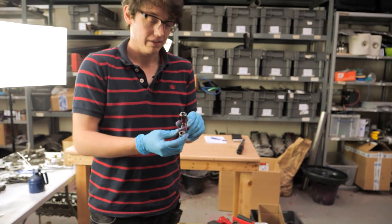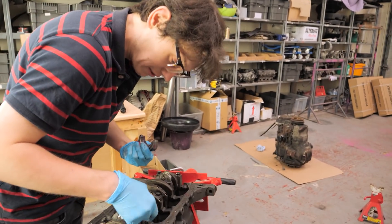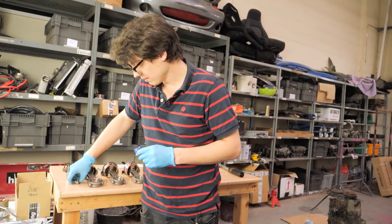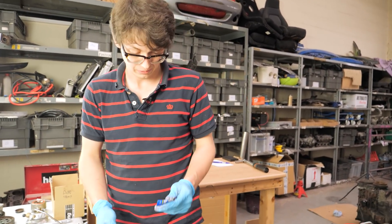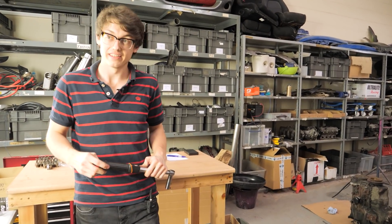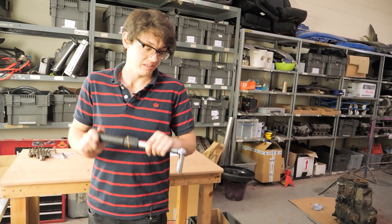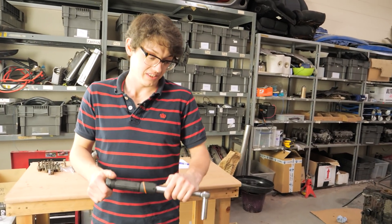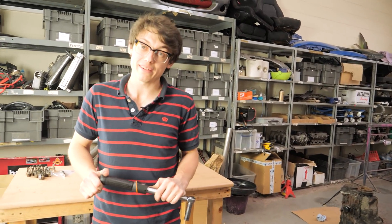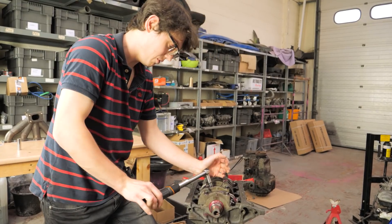Now we can put our cap on. Important to note that rod caps have numbers on one side - the big number will match the big number of its matched rod, so if you mix them up you have to get that correct again. The numbers have to go on the same side. We are using ARP bolts for these, and the torque spec is only correct if you're also using ARP thread lubricant. All four rods and pistons are now in the engine. The max speeding rods come with a booklet telling you the torque setting for the rod bolt size - these tiny rod bolts call for about 28 foot pounds.